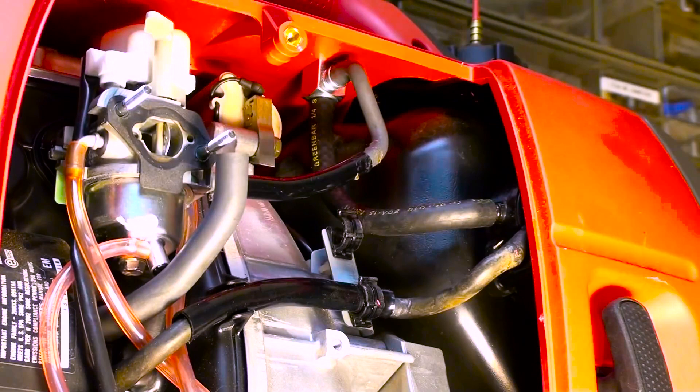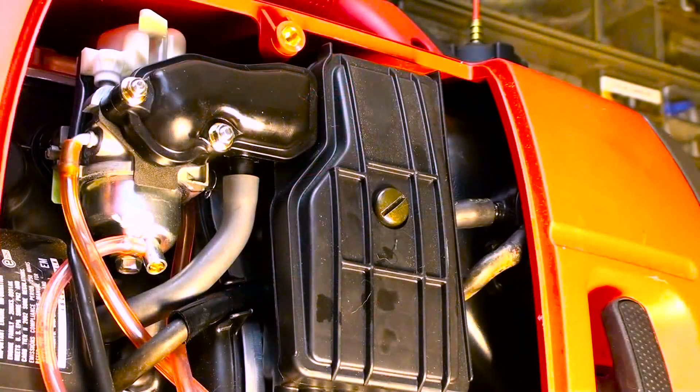Now up on top, what you can't see is the valve. I'll go ahead and put this back together and show you what it looks like assembled. Here's a shot of it all back together — air cleaner's reattached and everything fits well. The placement of the petcock is important because you want to make sure that it's back far enough away that it doesn't pinch any of the fuel lines, and that's where we put it and it works out well.